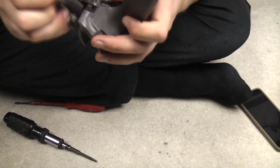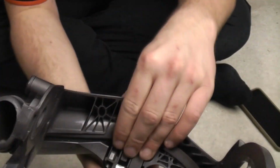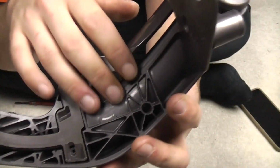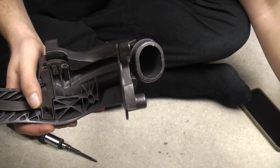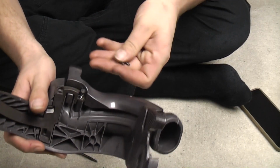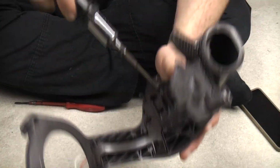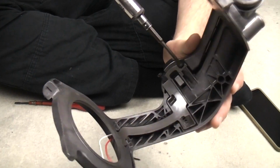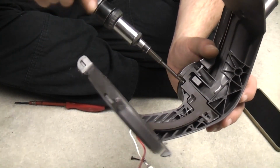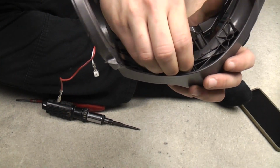And now this is very fiddly because you need to pull the yoke lock down and basically push it back. The prongs have to poke out and basically it all has to sit really flush like so. Then we can put the 3 screws back in where they came from. This also holds down the pivot bar, stops it from springing up so much. Little springy sod. So 1, 2, and 3. Lovely, he says, not being able to get it in.